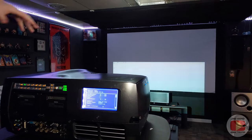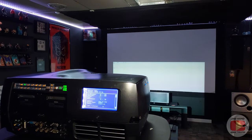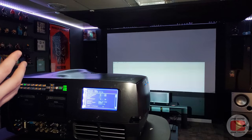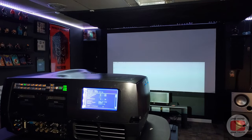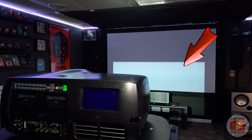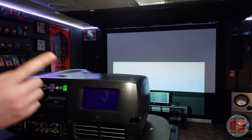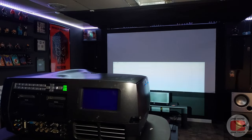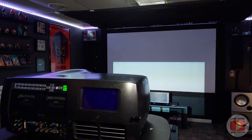So we'll hit the shutter button and it's going to open, and hopefully you can see the image projected there. You're going to notice it's probably going to be out of focus because of the ISO settings I have to use to make it bright enough to see everything. Even at like 6,000 lumens it might be too washed out. But it does have a pattern of lines for screen sizes. You'll also notice lines going up and down on the projector screen — what that is, is because this is a DLP projector with a color wheel, and those lines are the color filters of the color wheel flashing in sequence. The camera is quick enough to pick that up where our human eye normally doesn't see it.